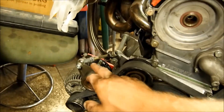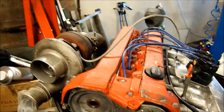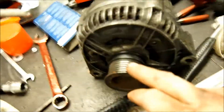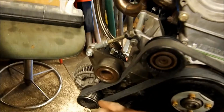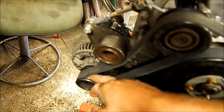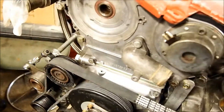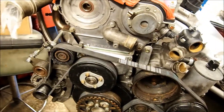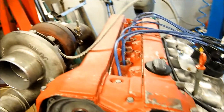Before that we did this with Mika Klemela, who came up with this idea — you need a good alternator. I also changed this pulley wheel because I earlier had six grooves and a six-groove belt, but actually on the old engine I bought it was an eight-groove alternator pulley. So now I can use an eight-groove belt, which is really good because it will grip a little bit more.